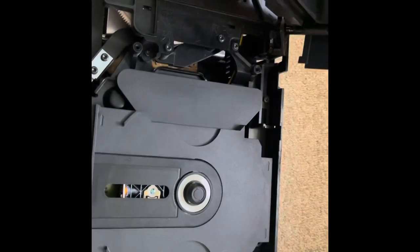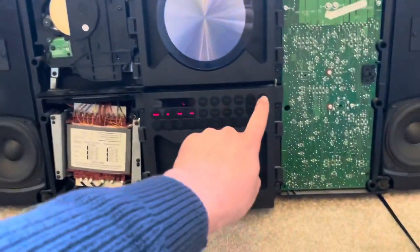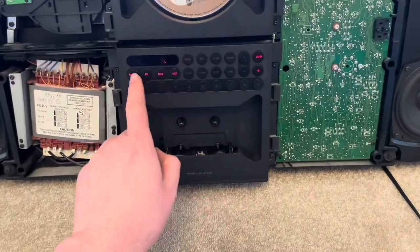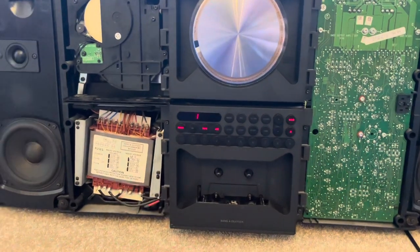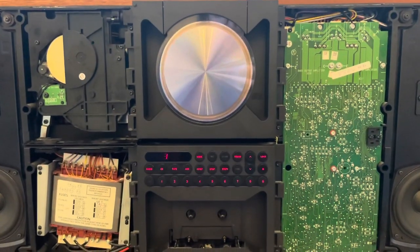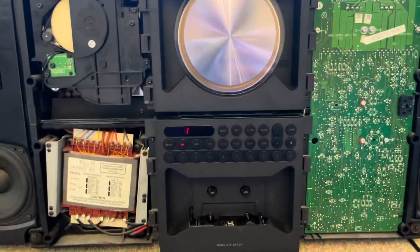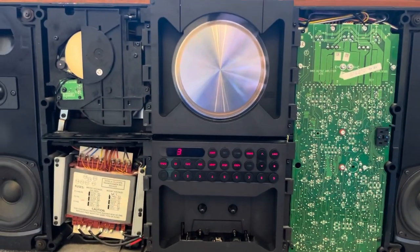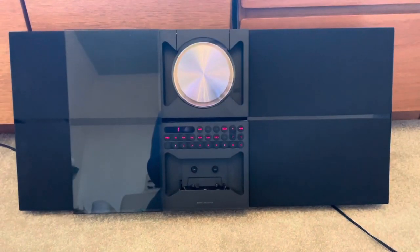Good time to check that belt whilst you're in there. Put this back in — twist it in the same way and make sure it locates back in the track. Before I put the cover back on, I think it makes sense just to put a CD in for a quick snippet of audio to see if it works. Success! The door mechanism is working without the glass on — skip through and it does work, the CD is spinning. Excellent — so I reassembled it.